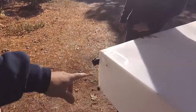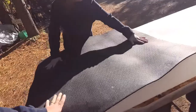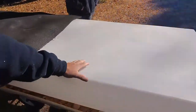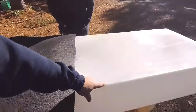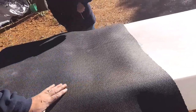This is where the fill will go in from the sinks and stuff upstairs in the bus. I'm going to cut this rubber down the side because there's not enough space up in there. I want a layer of this rubber so the plastic tank is not rubbing on the metal of the bus — it'll be pinched up against this nice thick rubber.